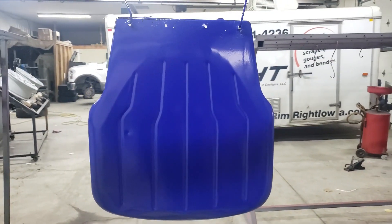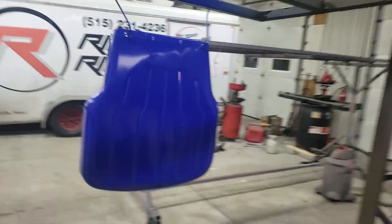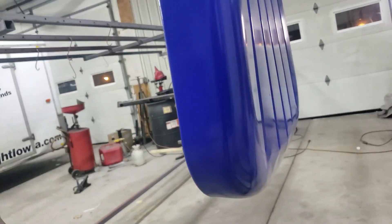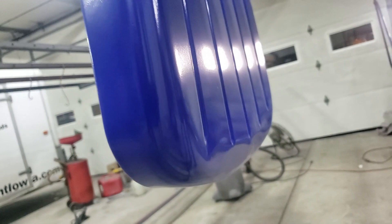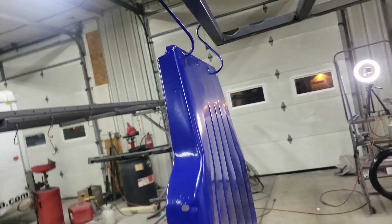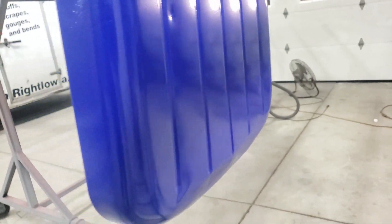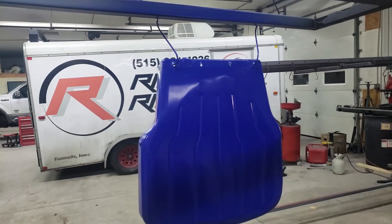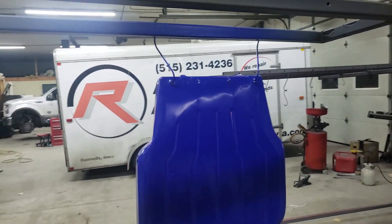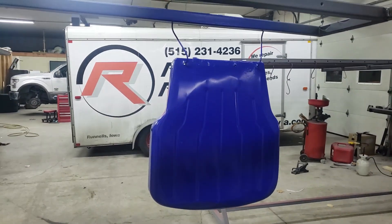There's the final product. It looks pretty good other than that big dent I didn't take out. No more back ionization anywhere, and it's actually got a better finish than before — it's a little smoother because we were able to sand out a lot of the imperfections. So there you go: that's how you fix back ionization and recoat without having to strip all the way. Thanks for watching — make sure to subscribe and we'll catch you on the next one.